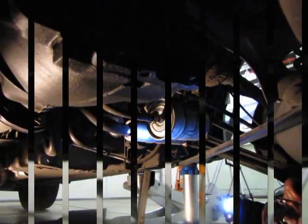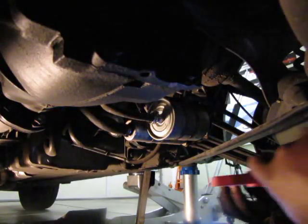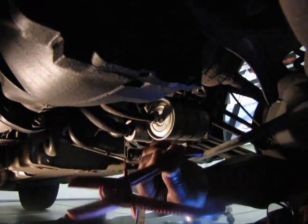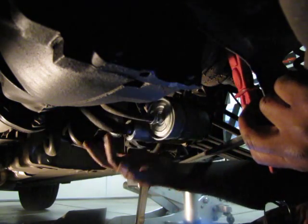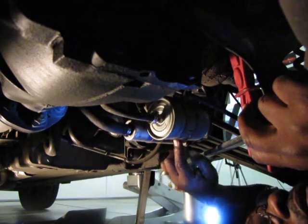Man, there's just not enough light under here. All right, so one thing you want to do is look at this little clamp here. I'm going to clamp off this hose. This is the supply hose from the gas tank to the fuel filter. So you want to clamp that off so you don't just drain all the fuel out of your gas tank